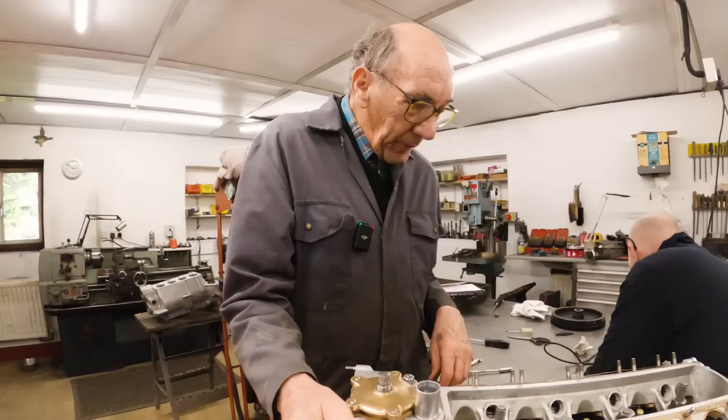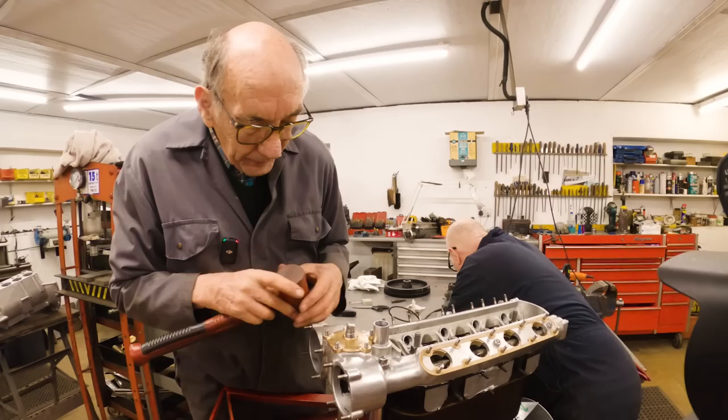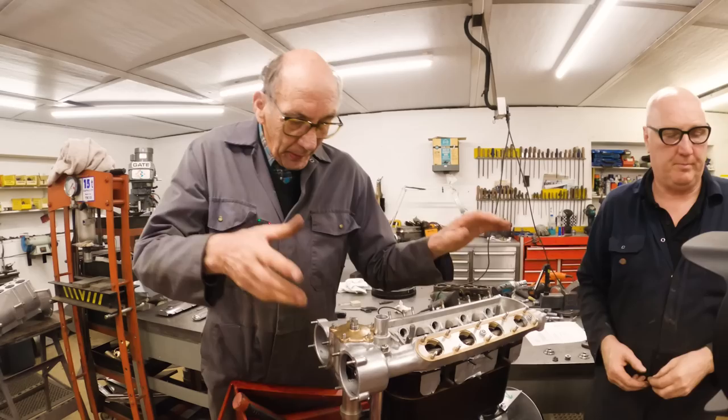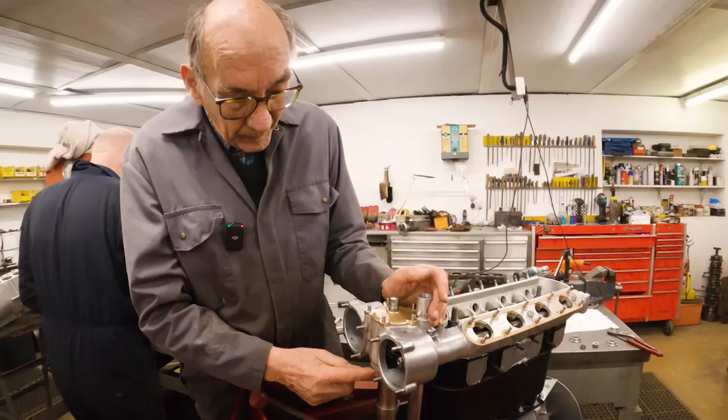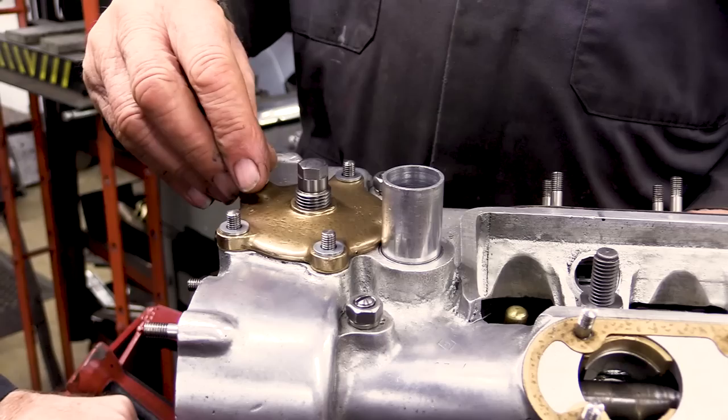Make sure that's back right off. And then you tighten that down, and then obviously, if you had to take the cam box off, the fat key and the thin key at the front there line up. So you shouldn't lose the timing. But this is a miracle, being able to move this round and get it absolutely spot on. So that's a big help. Perfect.